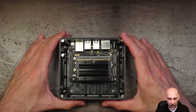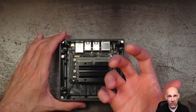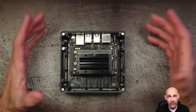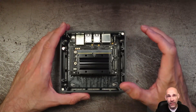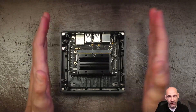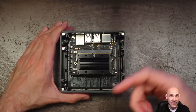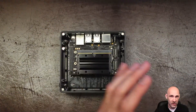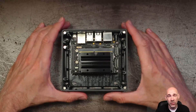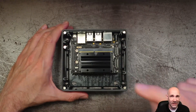The storage is going to be the key for the Flux node. To get at the storage, you've got to take four screws out, take the device out of the case, and then you'll have access to the M.2 slot — that's where you would populate a 250-gigabyte M.2 SSD. That will give you the storage space and the speed you need for running the Flux node. On their website, they go into detail about how to set that SSD up, basically migrating the OS over to it. I'll also direct you to the Medium post that Valter created for this device specifically, on how to prepare it to run a Cumulus node — I'll put a link to that in the description.